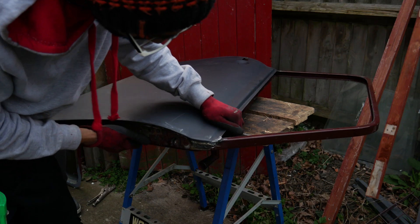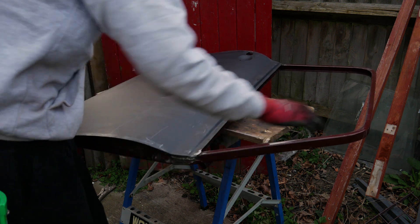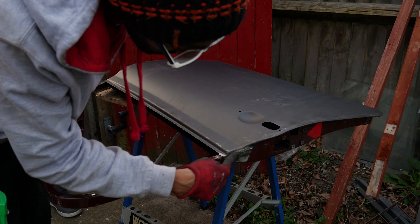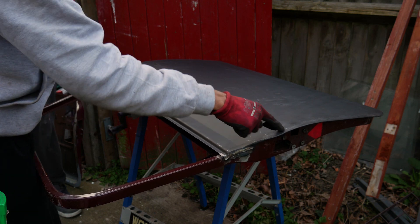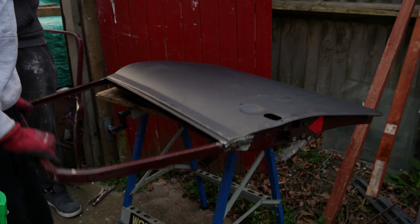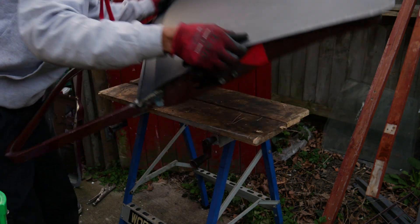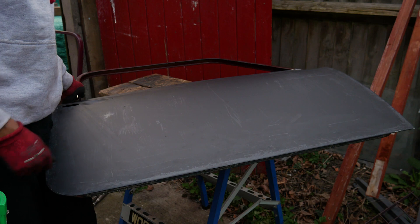Right, so that's one door fully complete — one seam here, tack over the top here, there's another tack here, and another seam all the way up here. One more thing: remember when you are dropping the skin in line, make sure this little drilled hole for the handle lines up with the original frame on there, and it should be perfect. But that's it — complete. That's how to replace a door skin and repair the bottom plate. We'll catch you in the next video, guys.